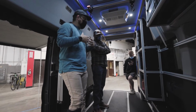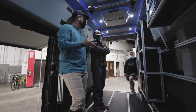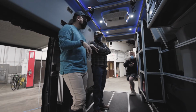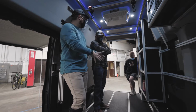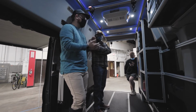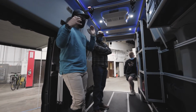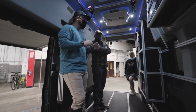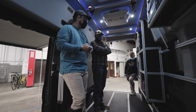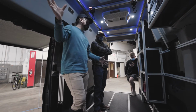With our van, we add in a whole bunch of 110 AC outlets in here. Just like in your house, everything is AC powered. All of our camper van batteries, whether they're lithium or AGM, are all DC powered. So to have these coffee makers, hair dryers, things like that work inside of here, we have to convert that DC into AC. And we have 5 locations where those AC outlets are.